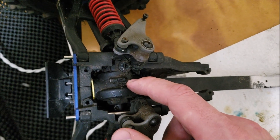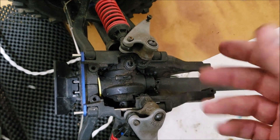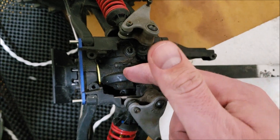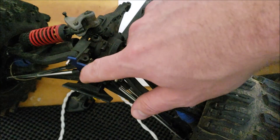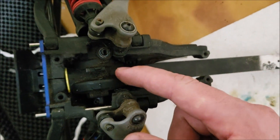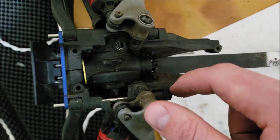I'm just about to take out the rearmost diff, and I just thought I would show you how it looks in the carriers. The ring gear is on the right side looking from the rear — this is where the rear bumper would be — and then the pinion comes in in the middle. As you can see, I had to carve apart these carriers quite a bit.